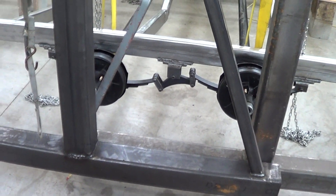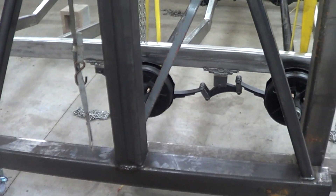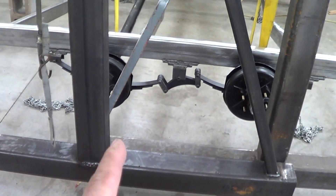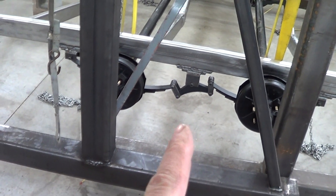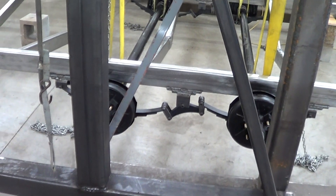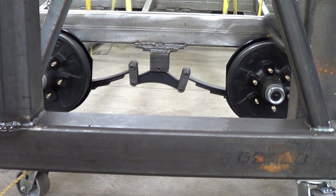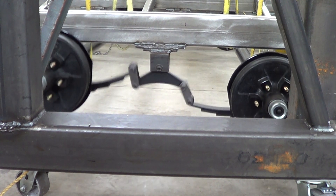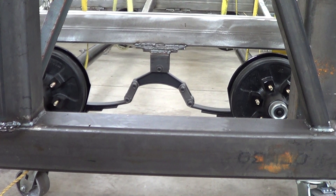So there you saw what happened when I took up the slack on this strap and raised the front axle — you can see this pivot is pivoting, and the shackles are ending up back where you want. So eventually if I keep raising it, it'll be nicely aligned. This video is basically just a quick exposé on what can happen with this double-eye leaf spring setup.